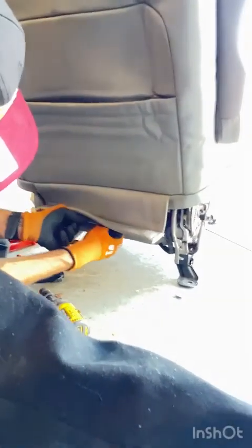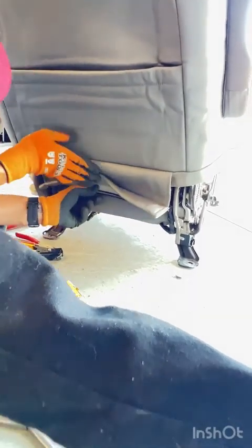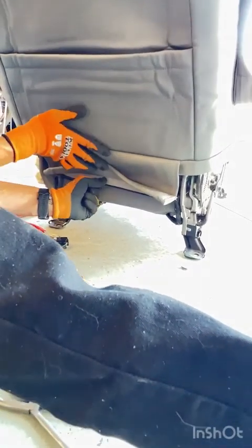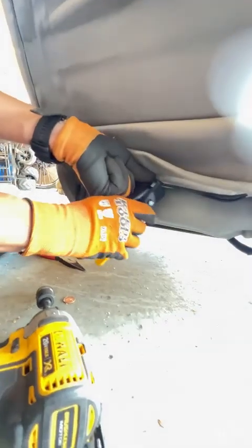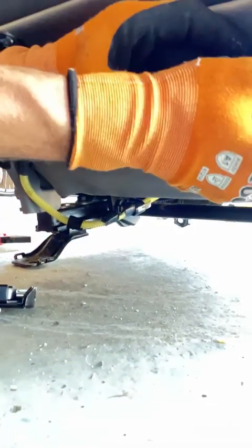Pull the center down and just hold your 2 ribs together. And again, you can use the hog ring pliers just like the manufacturer intended. Oops. We're just gonna give those a little extra pinch. I feel like that one kind of slipped out a little bit. And then one over here on the right.